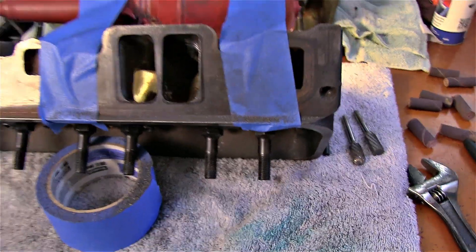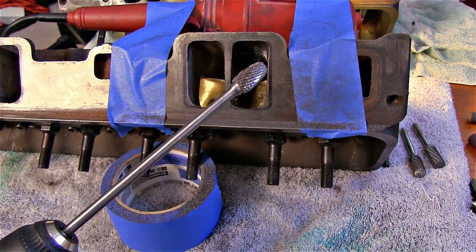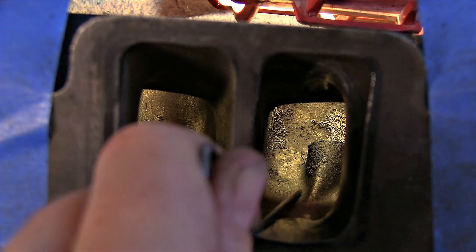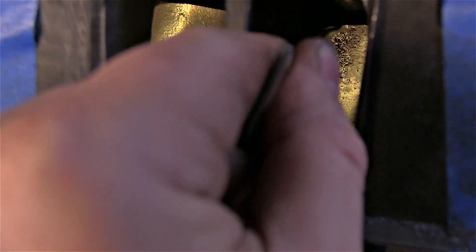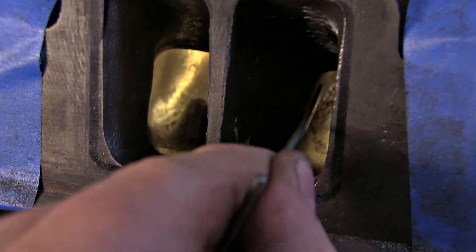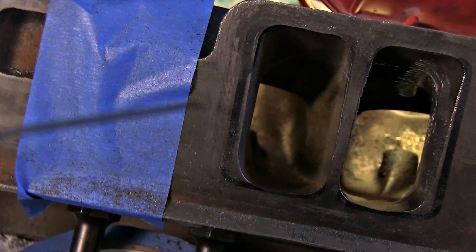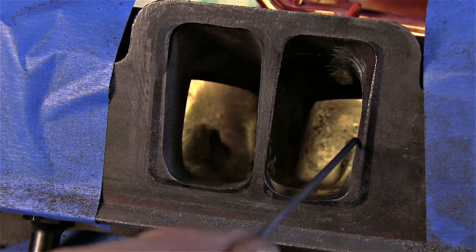It's hard to get the camera in there, but let me show you what I'm going to do. Right here the surface is not flat — it's uneven. I want to flatten it out all the way to the valve guides, and then move metal in this area all the way back. There's a casting line in here — I just take material out to that casting line, because that lets me know I've taken the same amount of material out across all the ports since they all share the same casting line.